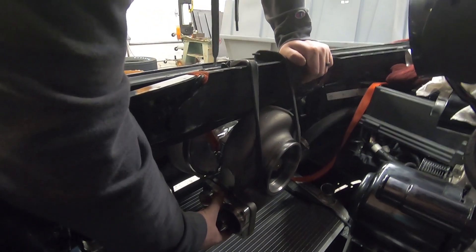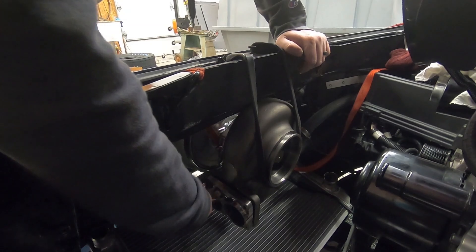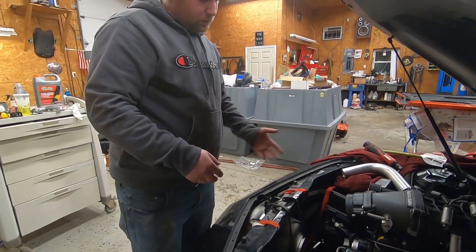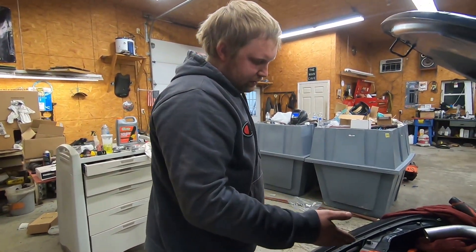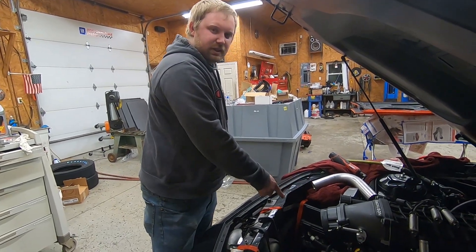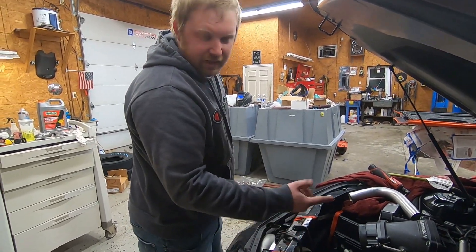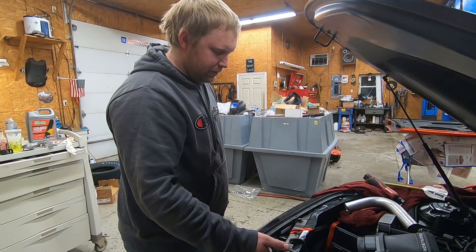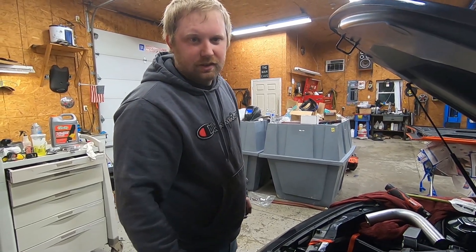I'll probably let go of it and it'll put a hole in our radiator — don't do that. It'll sit like that, and we'll just come off of here and snake this one around. One thing we're going over before we make the hot side is the turbo drain location. We'd like to run it over to the passenger side of the block, but the alternator is going to go over there. So we're going to have to snake it through on the driver's side and make it at a good angle so that it drains. Before we weld up the hot side pipes, we'll probably come up with a drain idea so we're not shooting in the dark.